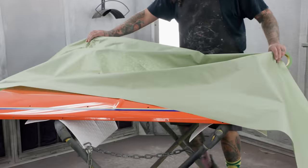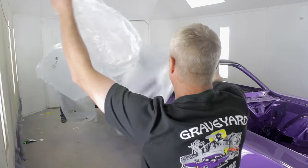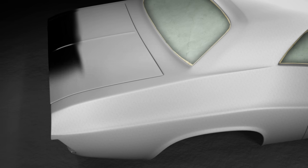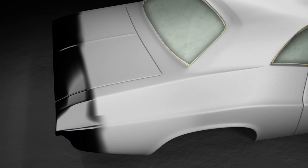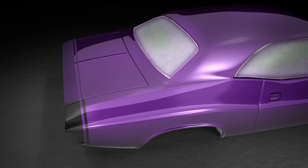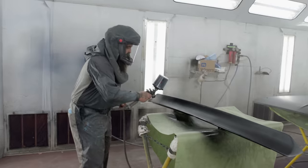It's interesting how they did the Bumblebee stripe when they painted them on. They'd actually lay the color down first. So if you had an FC7 Plum Crazy Purple Challenger with a black Bumblebee stripe, the factory would paint black on the deck lid and quarters, probably halfway up to the back glass — way past where the Bumblebee stripe would go. Then they'd come back, mask the black off, and paint the actual car. That's the way the factory did it, but of course Will has a better idea — he knows more than Walter Chrysler, apparently.